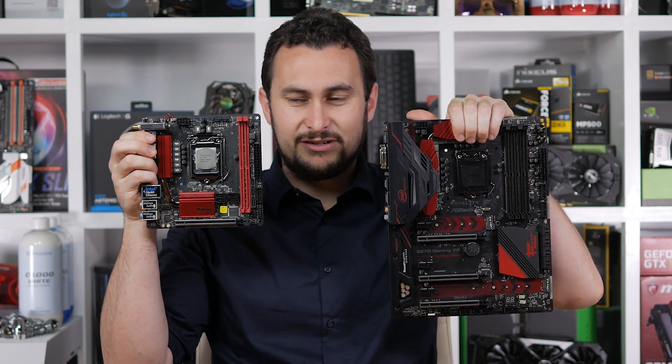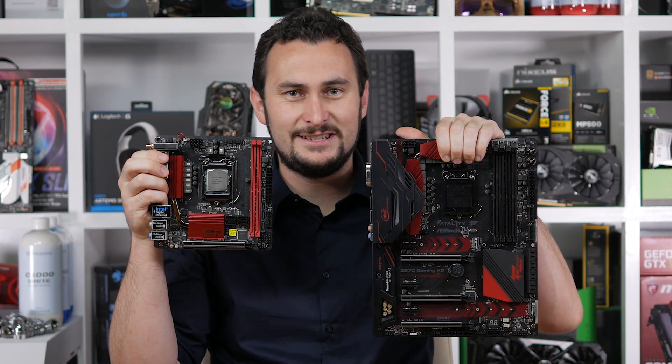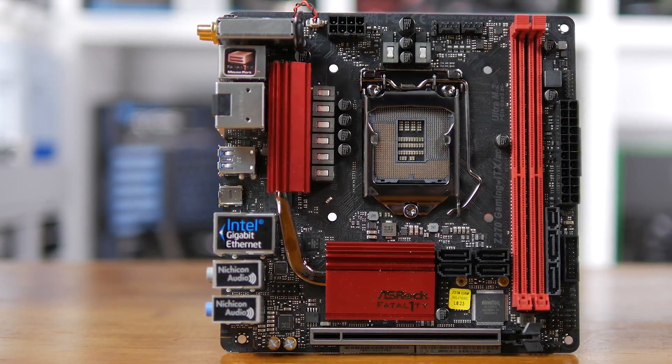That's actually a good size comparison between the two boards. For a long time now, the chipset and by extension the motherboard haven't really been performance-defining pieces of kit. Ever since Intel released Sandy Bridge back in 2011, all the functions of the North Bridge now reside on the CPU — things like the memory controller, which used to impact performance, are now all on the CPU. This means that unless you're testing multi-GPU performance, benchmarking your motherboard's gaming performance is a bit pointless.